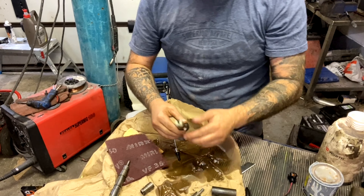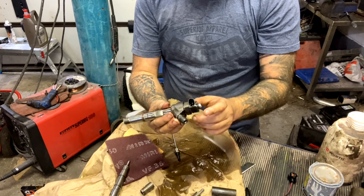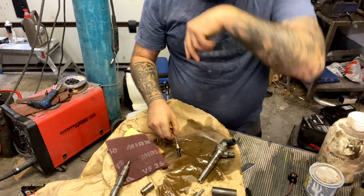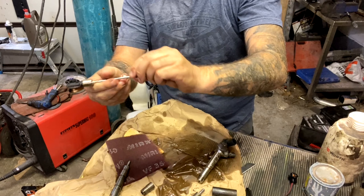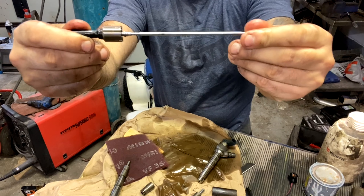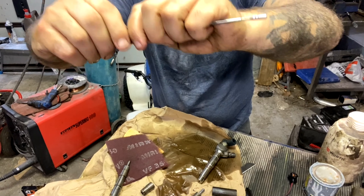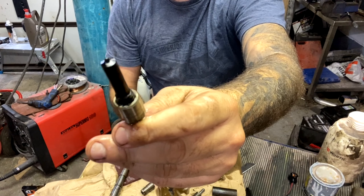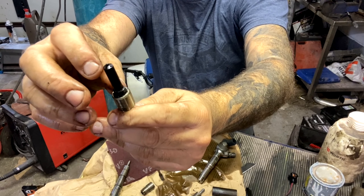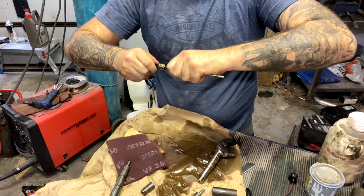So I've got both parts here nice and steady. Pretty much that's it — if the electronics on these go, I'm not even sure if you can rebuild them or buy a new electronic part. There's a spring here — take that spring off. So that's your injection needle into your cap. If you look, I'm pulling at that and it is very, very tight. That's what carbons up. On the top they have six or eight little injection holes on the injector tip — and that is tight.